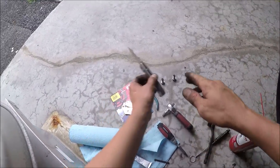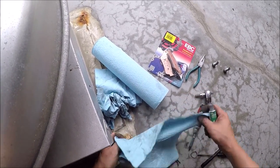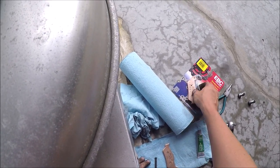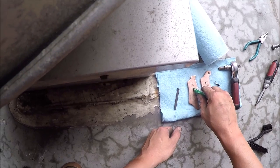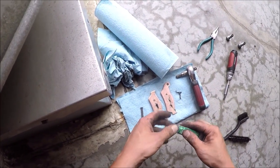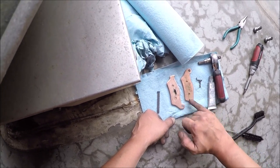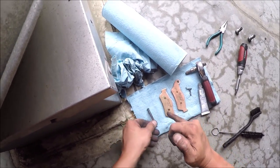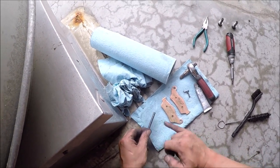The next step is to open up your brake pads. We open up the pads — the knife can go away. Make sure you take good care of these pads: find a nice clean area and take them head side down and put them down. Take a tiny bit of grease and apply it like that — that's all you need. The idea of this brake grease is to quiet down the pads and make them smoother. You don't need much at all, just a tiny bit.